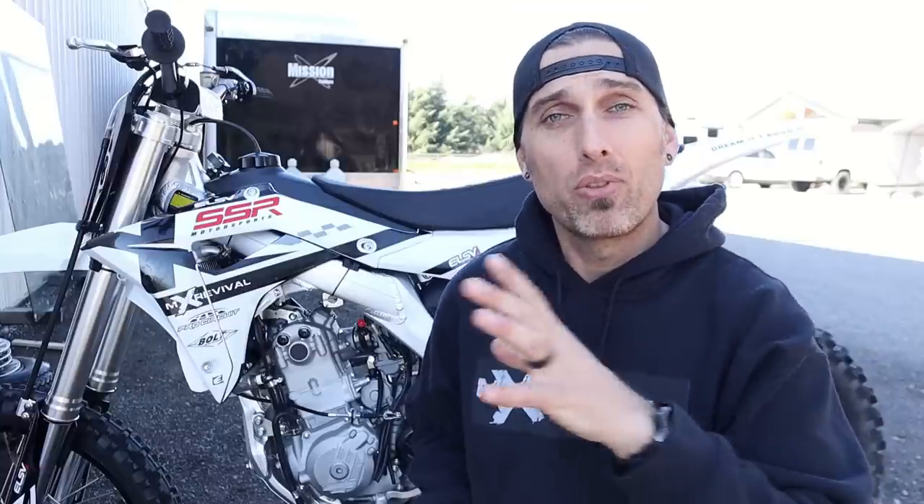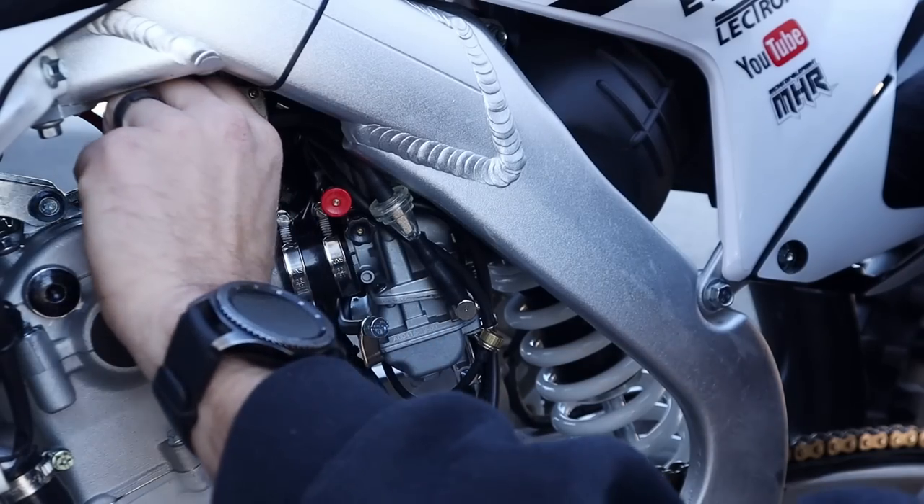To make this a true-to-life test, I installed my stock exhaust pipe since most of you will have the stock pipe without a spark arrestor, and put in my stock air filter — this time with oil on it, unlike when I got the bike from the dealer and found it unoiled, which was likely an improper PDI. Those things — oiled or not, spark arrestor or not — can affect the test, so I'm trying to keep this as close as possible to buying a 22 off the showroom floor. Also, rolling the throttle back it feels like it tops out sooner, as if there's less room for the slide to raise. That's a welcome change — I felt the throttle throw on the old carb and the Lectron were kind of long, and I like a faster style of power.